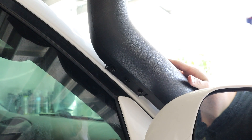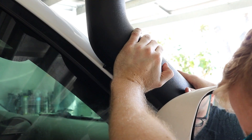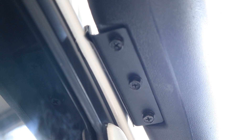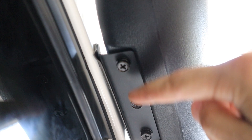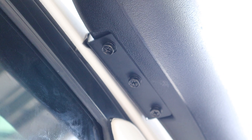Once the surface is clean, peel off the backer on the tape and push it tight against the vehicle, holding in place for about a minute. Once the adhesive is on, I loosened all the bolts to give a little more play, which took tension off and allowed things to sit really nice and flush. I think this is going to hold up really well — I've had rear diffusers, front lips, and trunk lips all installed with this Gorilla Tape, holding up for several years under high-speed conditions. This also prevents scratches on the vehicle and means we don't have to worry about riveting or drilling into the A-pillars.